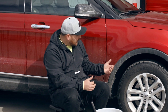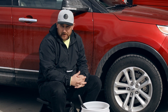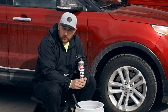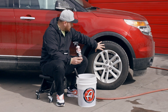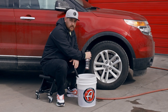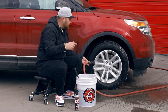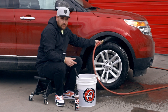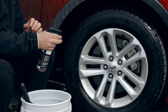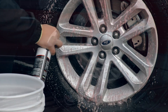With a daily driven car like this, the wheels and tires and fender wells are going to get extremely dirty. You're going to need to clean this car more often because it's getting driven more and getting dirtier faster. Our wheel and tire cleaner is the perfect product for this — it combines cleaning the wheels and the tires as well as the fender wells all in one, so you're not reaching for multiple chemicals. With wheel and tire cleaner, I'm not going to spray this directly on first; I'm going to get as much of the dirt and grime off first using the fire hose nozzle. Ideally you want to use a pressure washer, but just using the fire hose gets a little bit of the excess dirt and grime off. Now I'm going to take wheel and tire cleaner and spray this directly onto the wheel and straight onto the tires as well and into the fender wells.